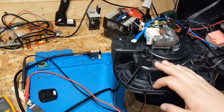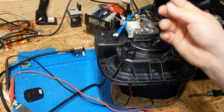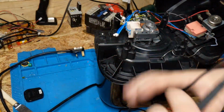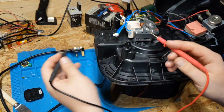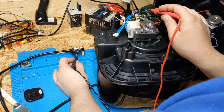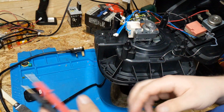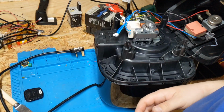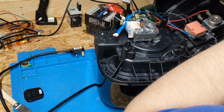This particular model, power goes via the micro switch to make sure the drawer is in first, then to a little timer. I took it out. Maybe it's silly, I was thinking it's some sort of electronic thing, but it isn't that complicated. So again, live pin to heat element is good. So that must mean there's a fuse, must be some sort of break in the neutral then. Can I stop it from working?